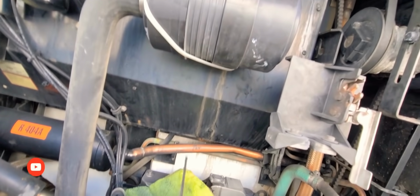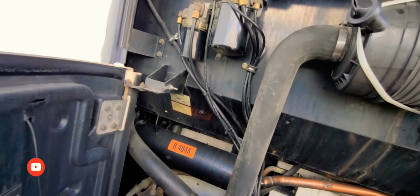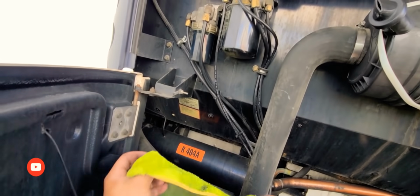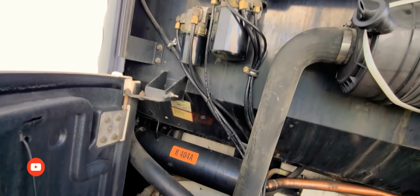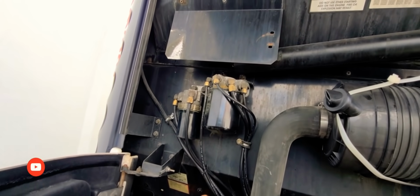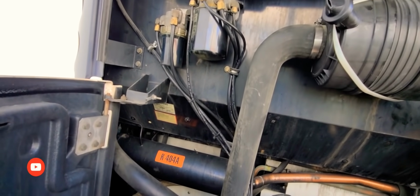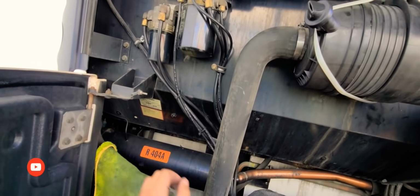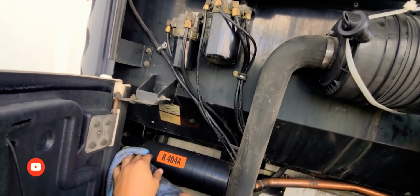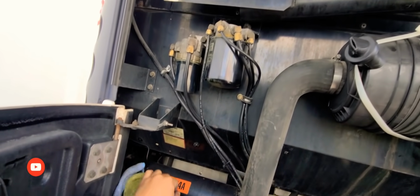Now next, why did I get dirty rags? Okay, here we go. The rags are used for these things here. See this line here, this rubber thing here. If diesel starts to fall on this a lot, it's gonna eat through this. So how do you prevent it? Easy, just put rags on it. That should be plenty of rags. You should be good with that.